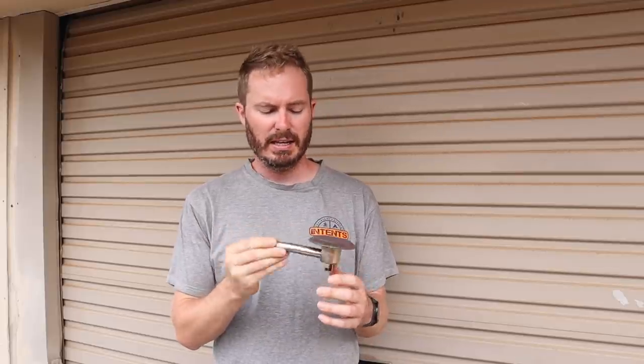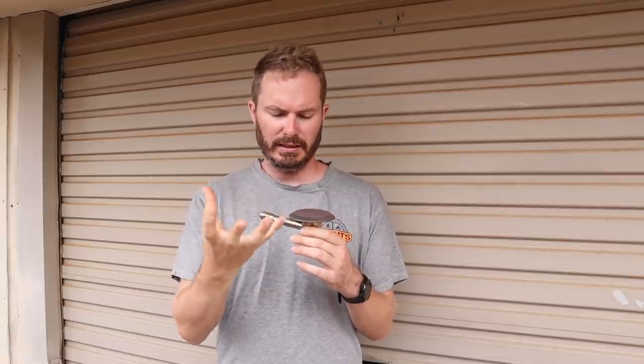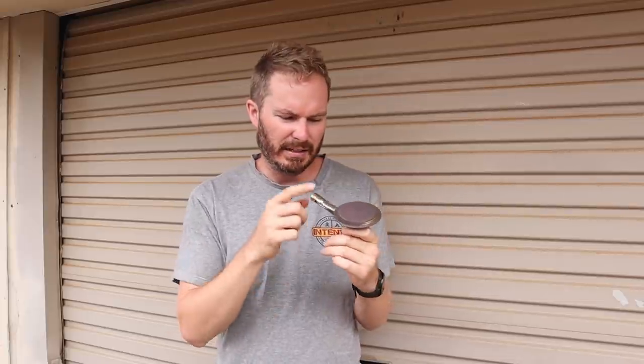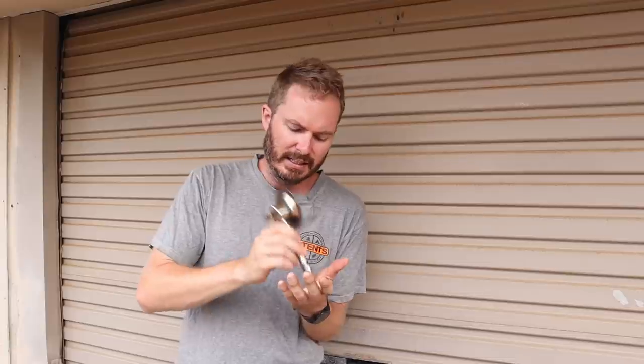Here's potentially part one of your problem. That's my middle burner — this is the one I was having the most trouble with. What happens is the ones you use the most are constantly heating and cooling, expanding and contracting. You can see there's rust on here, and what could be going on is that as it's doing that, the rust is all flaking and falling inside the burner. So just give them a bit of a tap out. If they're really bad, you can do a rust treatment on them. A bit of compressed air blown down there will loosen everything up.